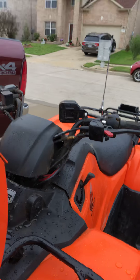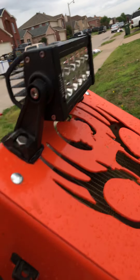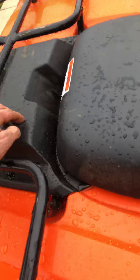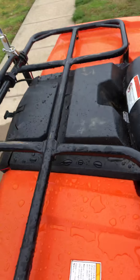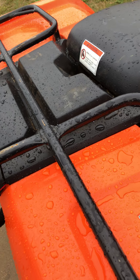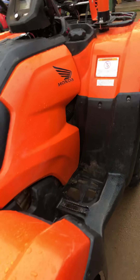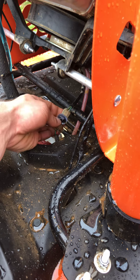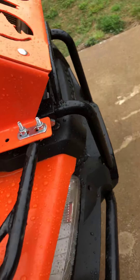I've got my winch hook up there. I turned it sideways. This is my forward light bar, and that is my rear light bar back there. I have them all wired into my battery box. It's a rat's nest right now — I'm not too entirely loving that; gotta figure something out. But I've got all that wired up to relays. Everything on here is a relay. The front light bar is on a relay. The nice thing about the SS Custom relocate is I didn't have to add any wire — I just stretched my vent tube just a little bit for the fan. Fan kicks on, kicks off. Perfect.